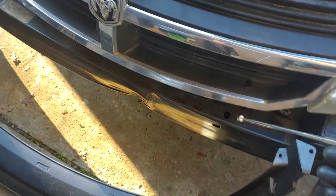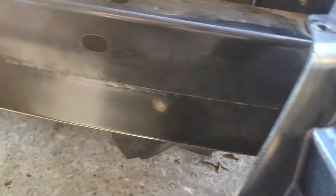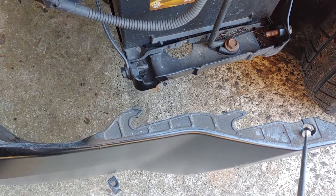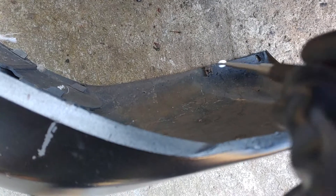All right, so I took most of these out. This just fits into holes down in the bumper on this side. You flip it up here, and you have some 10 millimeter bolts holding the bumper — take those out and the top portion of the bumper will come out. There's a catch here, and then there's a 10 millimeter bolt there. Remove the 10 millimeter bolt and it'll pull out. You also have to remove all the bolts going around the side and bottom of the bumper — might be a seven or eight millimeter. It's not terrible, but that's what you'd have to do to get the bumper off.